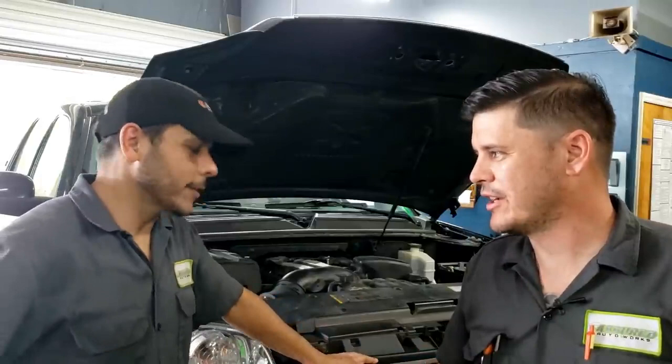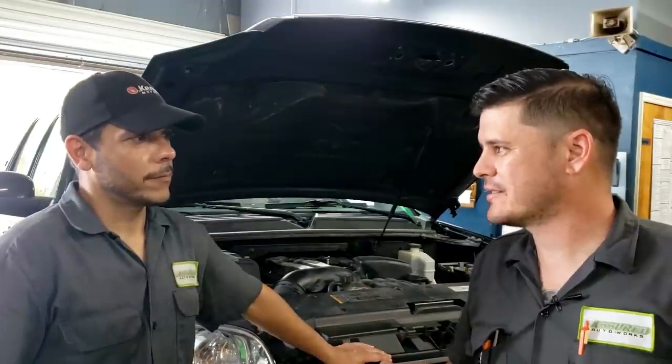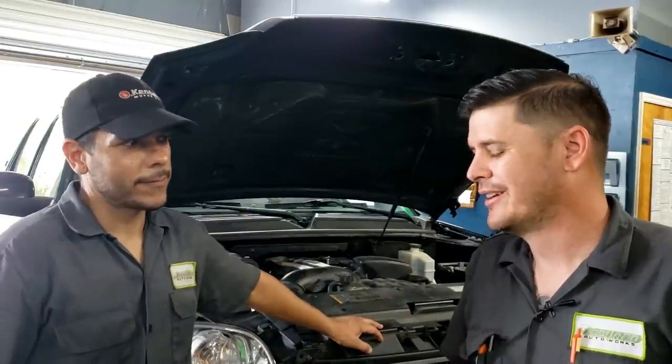You looked at current for all four cylinders on that bank, which is injectors and ignition, right? Correct. And you used a secondary lead to look at 6, and you weren't seeing anything, right? Correct. So you moved it to other cylinders, and you were seeing the secondary lead waveform on the others, but you weren't seeing it for 6, which is the cylinder that's misfiring, causing the run rough condition. Very cool. We looked at it on a Modus.